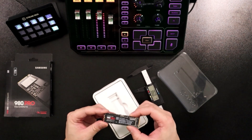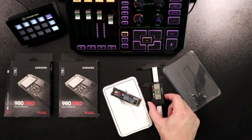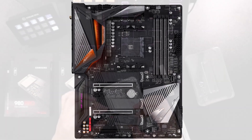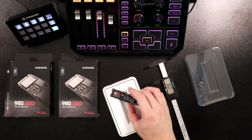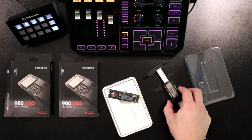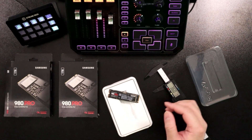This build I'm doing right now is literally going to be my editing PC. It's a very interesting build because it's not just going to be one of these — it's going to be two, actually going to be four or possibly six. It depends on whether I go TRX or with the X570 or X670. With the X570 I don't have enough PCIe lanes to run a 4x4 RAID, which requires 16 PCIe lanes, and the Ryzen 3000 and 5000 only have 24 PCIe lanes. If I'm going to be running a graphics card on top of that, I can't run four drives plus two. For those who don't know, for editing you need three hard drives, and I'm using six because each pair is going to be in RAID 0, which will double my bandwidth.